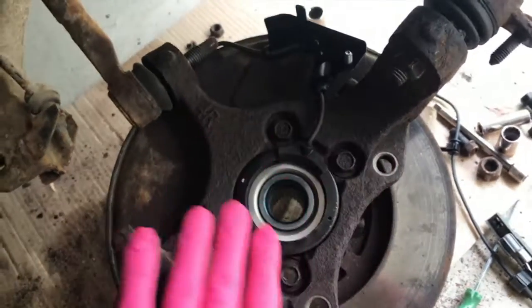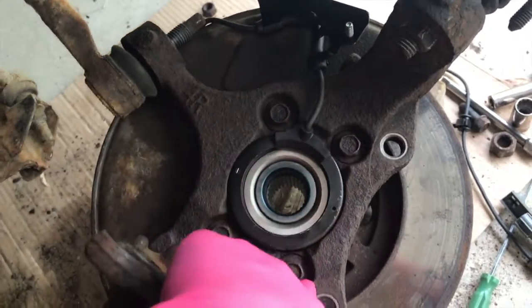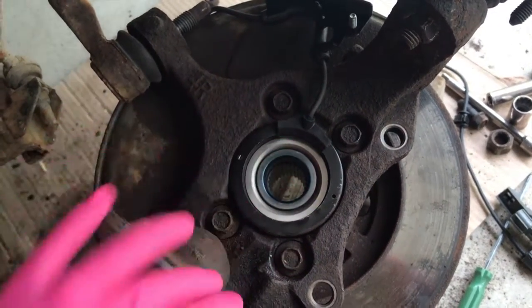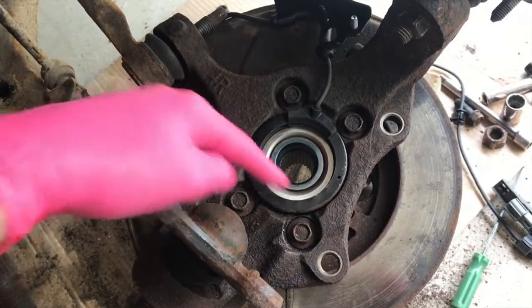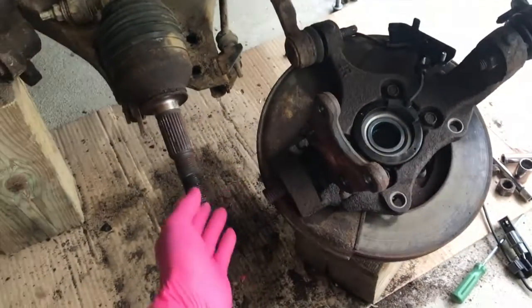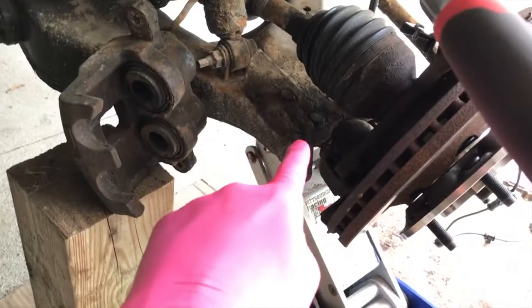At this point, everything is resecured on the actual hub portion, and these 4 bolts, 15 millimeter. Remember earlier in the project I removed 3, and then we had to take all of this apart to get access to this bolt. Well, before putting everything back together now, I just resecured all 4 bolts. From here, I'm going to shift it in position, connect it here, align it properly with the splines, and secure the 4 bolts below down here. All 4 bolts and nuts secured.